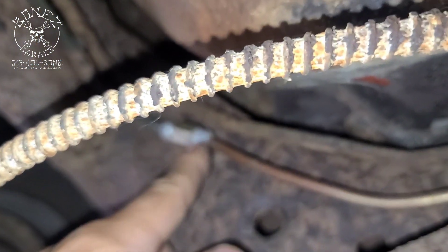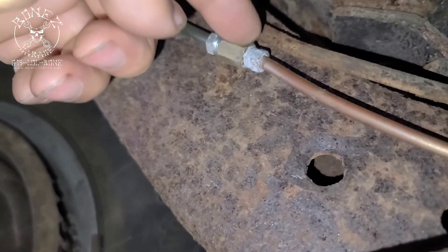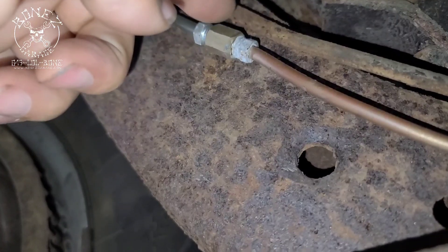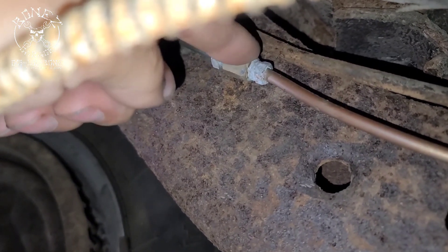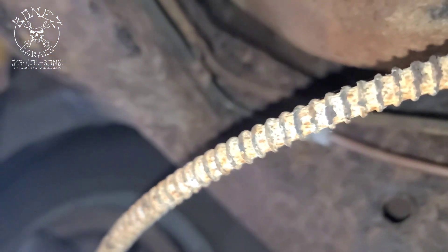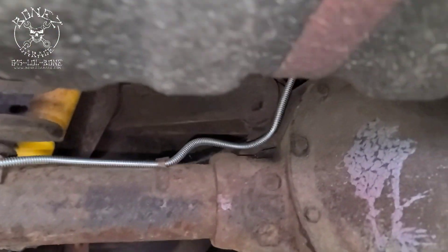This copper alloy is so malleable that sometimes if you make these fittings too tight, the fitting will actually break the interior of your double flare and cause a small air leak. Sometimes it won't even drip fluid — it'll just suck air into it. We've had that happen before, so I don't like using that stuff. Here are the brake lines I made a couple of months ago for the rear axle.